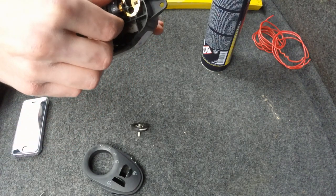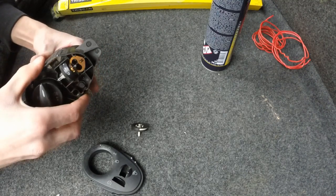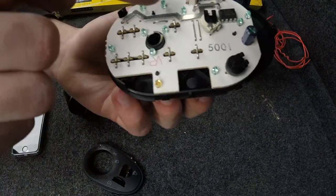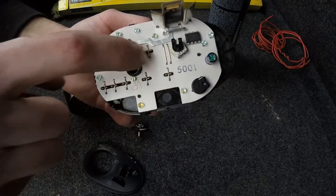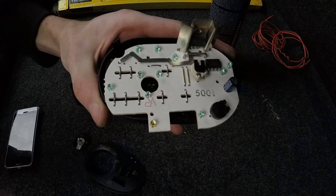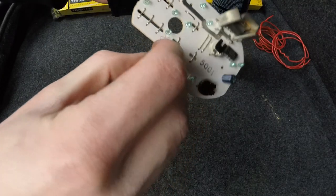Try to take your time and do not rush. You will need to pop out the other four pins that hold the assembly together, and if I remember correctly you had to twist the switch to the left position and after that you could remove it. Now you're left with only the circuit board with the LEDs on it, and the circuit board is held in place by those wires in those clips. Make sure you gently pop it out, hopefully with a plastic tool — I did use my flathead screwdriver, which wasn't the best idea but it was the only thing I had at hand. Now you have the circuit board in your hand and you can change the LEDs to whatever colors you want.